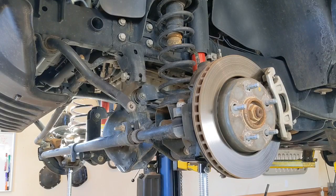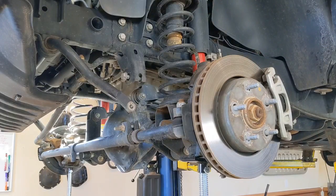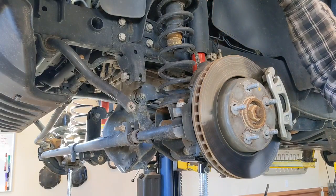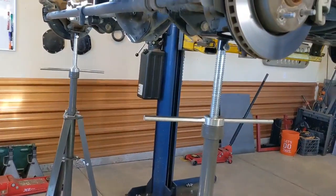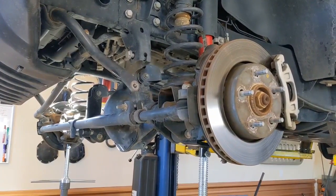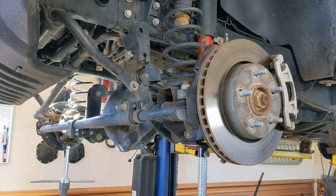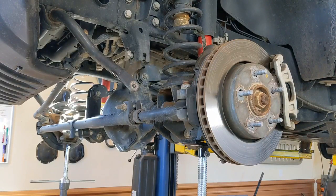A word of caution here. The instructions want you to loosen up the top shock nut, which allows the axle to droop. But you have to understand that once you undo these shocks, there's nothing holding the axle up and it'll come slamming down. If you're on the ground, make sure you have a floor jack — not jack stands — under there to hold your axle up. If you're on a lift like me, make sure you have your jack stands there to hold the axle in place. Once the nuts are removed, pull the shocks out and slowly release the axle so you can watch brake lines. The last thing you want is everything tumbling down and getting yourself hurt or breaking things.